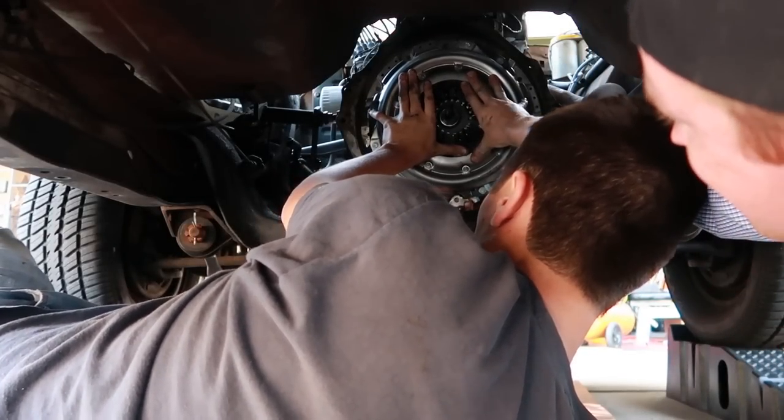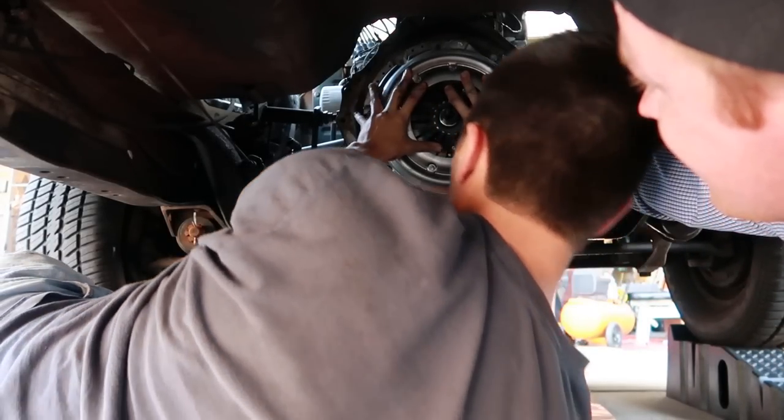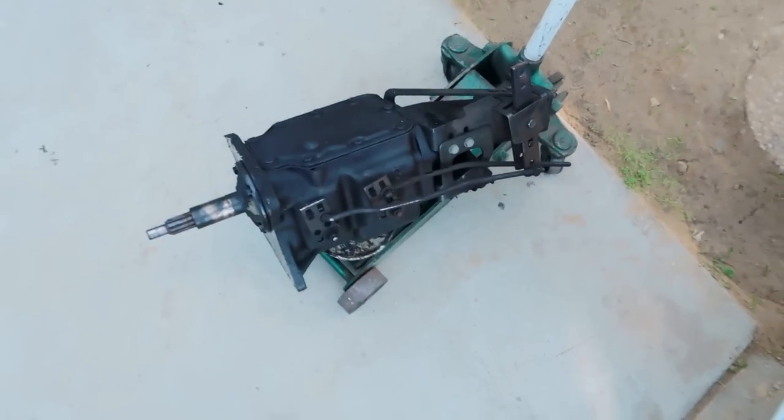You've got to put a bolt in somewhere — top is probably better. Find a spot, put the bolt in, and just go for it. So I kept forgetting — we're just doing a clutch, so we didn't have to take the flywheel off. I'm in that constant repetitive theme from doing mine, and my flywheel had to keep coming off. Doing a clutch is actually a lot easier than you might think if you've never done one. The hardest part is getting the transmission in and out.